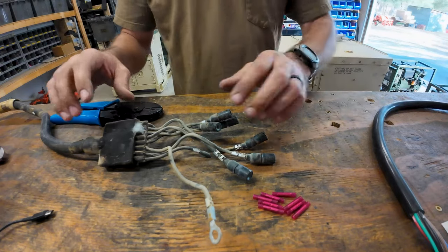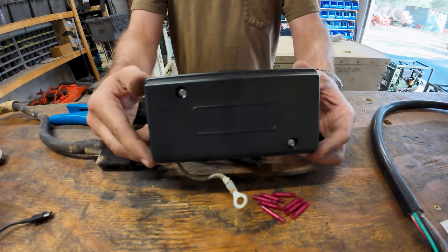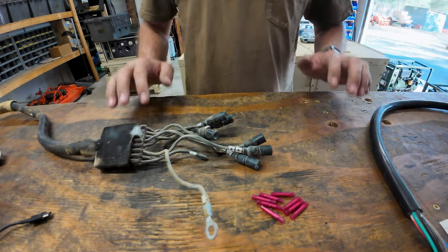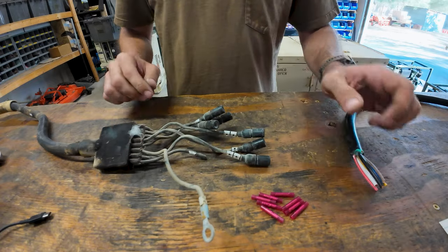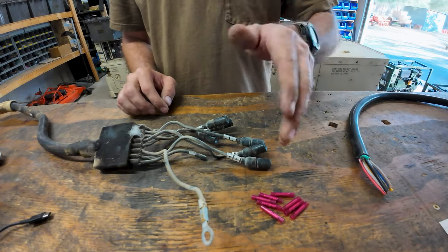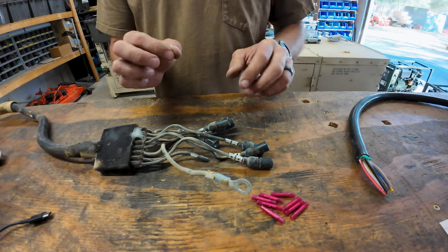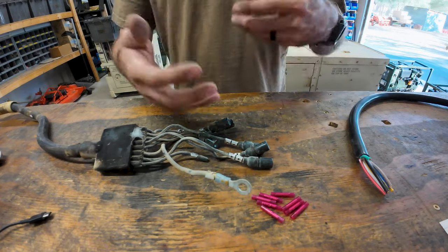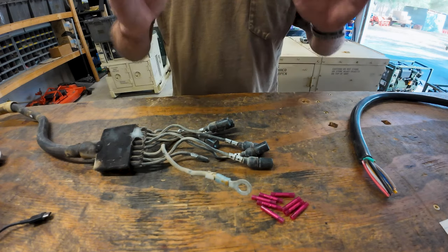So this is where you start making your harness and you start using the numbers. A lot of people, because they're building stuff with battery banks, like to use one of these junction boxes so you can charge a battery off of one of the 7-pin connectors like an RV does. So with a 7-pin connector, you're going to want to match the colors: the green wire goes to number 21, 22-460 goes to brown, 22-461 goes to red, and the white wire goes to your ground. If you're doing a 4-pin: 22-460 goes to your green wire, brown goes to number 21, yellow goes to 22-461. I'm going to do all this work and fast forward — you're just going to splice and butt connector everything together. I'm going to put everything I just said up on the screen for you to write it down.